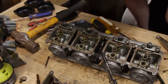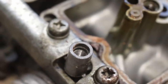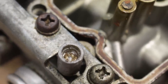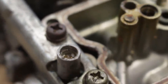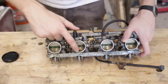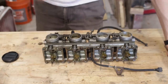Not the handiwork of my smooth-brained self, but the more I looked at this, the more I thought the carb body itself might actually be ruined. See, the threads for the screws are supposed to start just right after a little lip in the hole, but on the bad one those threads are completely destroyed, meaning even if the screw was removed and I bought a replacement one, it literally could not be in the spot it's supposed to be in. I'm sure I could repair the threads with a helicoil or something, but it could just be very, very mangled up in there and mess with some of the passageways. Probably repairable, but not by me.